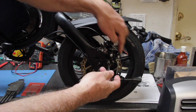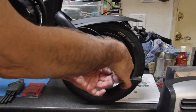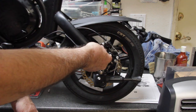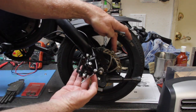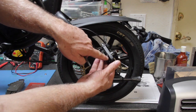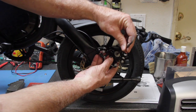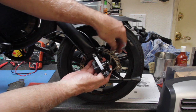You don't have to disconnect the cable to your brake handles. We're just going to pull the calipers off. Take your bolts out and the caliper will slip right off the disc. As we turn this over, you can look inside and you'll see the two pads. The part number on here is F180/R160. There's also an adjuster so you can adjust the tension on the pads when the caliper is sitting against the disc.